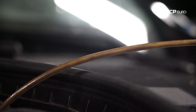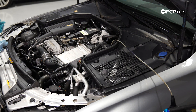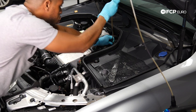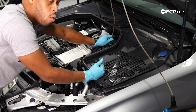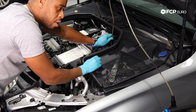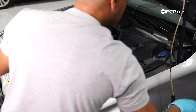When it's about complete sucking out the fluid, you're going to see a large amount of air bubbles and you're going to hear air escaping — those are all signs that it's just about done extracting. In the case of this motor, it's going to be between six and six and a half liters of fluid that you're going to get out; in this case we extracted the full six and a half liters. If you're extracting and starting to notice air bubbles but you're only at four or four and a half liters, you may just need to adjust the extraction hose — pull it up maybe a quarter to a half inch, as it might just be right at the base of the pan having trouble sucking the oil up.